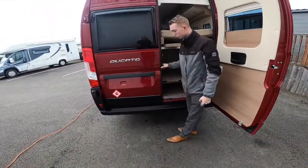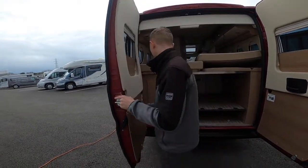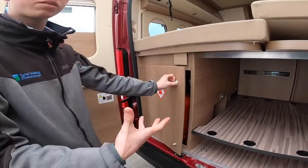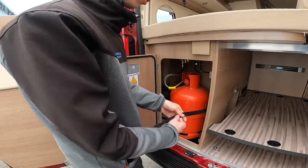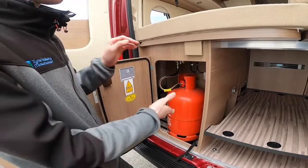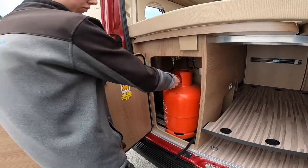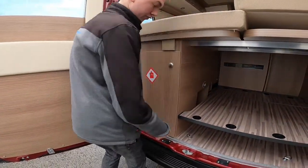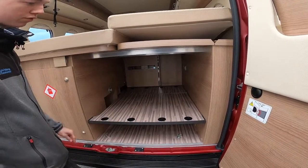On this side of the door you have your gas sticker, which indicates your gas locker is just behind here. You've got LPG — liquid petroleum gas — and you can fit two bottles in here. We've got our test bottle on at the minute which is a bit too big, but you can get two smaller bottles in. Strap them in, turn them off when you travel, and turn on when you get there. This is an easy pigtail — no spanner needed, just hand-tighten it; it's a left-hand thread. Then turn the bottle on and off at the top.